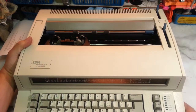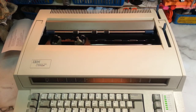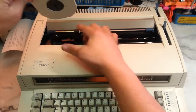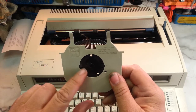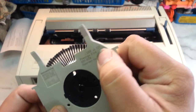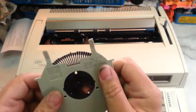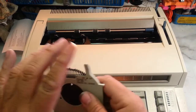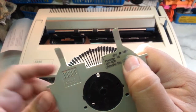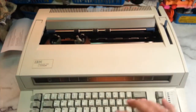So here's the famous Wheelwriter, commercial grade king of electronic typewriters. This typewriter uses print wheels that are coded so it knows what pitch it is. This one is a 12-pitch right here. So when you drop it in, all it's going to be able to do is type in 12 pitch. You can't change it because it knows what wheel that is. So the only way to change the pitch is to change the wheel to something like this, which is a 15-pitch — an even smaller micro size wheel. So let's put this in and I'll show you that wheel is set.